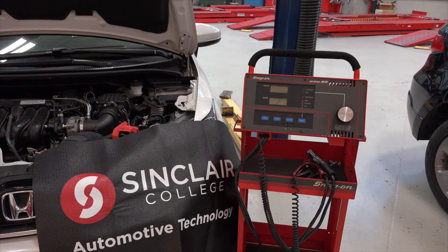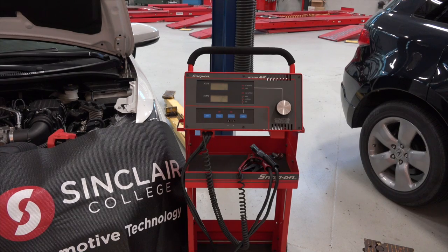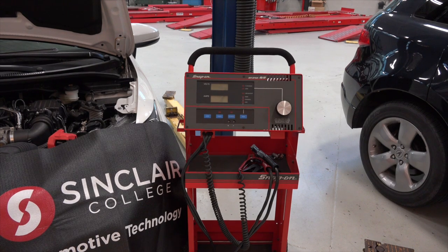Here's the other piece of equipment I mentioned for doing a carbon pile load test on the battery. This one's an older Snap-on — a little higher tech than the VAT 40 was, but not by a whole lot. As far as the connections go, it's exactly the same. The big alligator clamps are going to go on the battery — red for positive, black for negative. And the inductive amp probe again is going to go around one of the cables from the piece of equipment, since that piece of equipment is the load and that is the current I'm interested in looking at. That inductive probe goes around the equipment's cable, not around the vehicle cable. There is a time when we do go around the vehicle cables, but not for a battery load test.